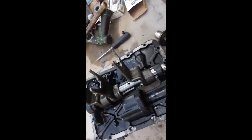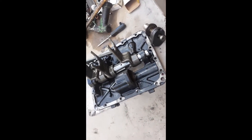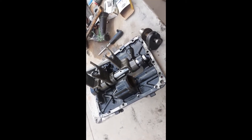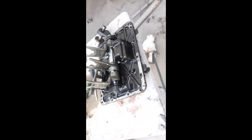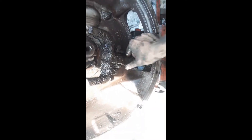These Eaton Fullers — I've never had one where you can actually do this in the truck. As you saw earlier, we have the transmission removed, so you're going to have to remove the transmission to do this. But it's not a bad thing either — you can check the actual condition of the clutch. Once we had this out, we noticed the fork bushings were completely gone, so it gave us an opportunity to take care of that. We didn't have to wonder later if we had an engine knock or something going on in the tranny. It also gave us an opportunity to take care of a stripped drain plug.